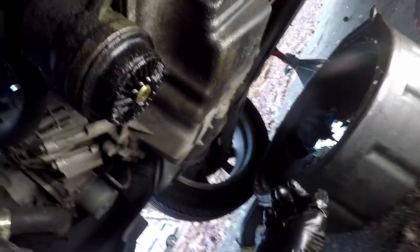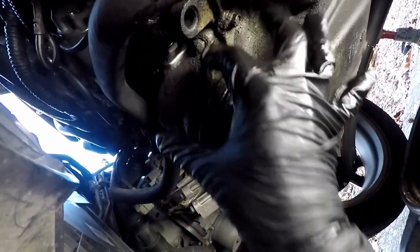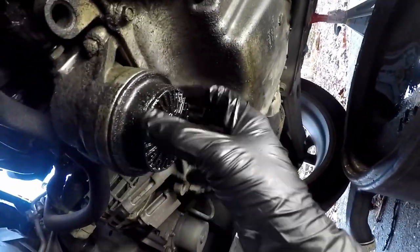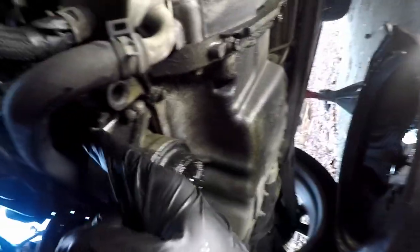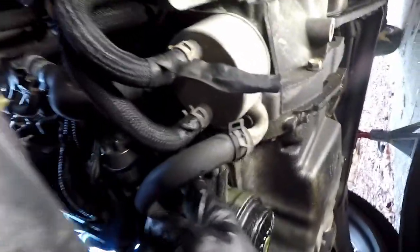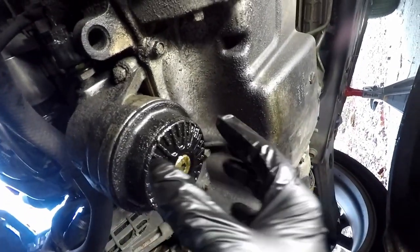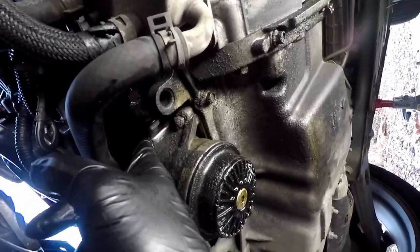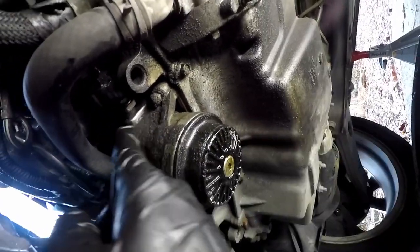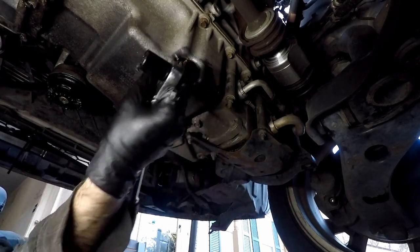While that's draining, let's take a look under here. You can see the caked-on oil on top of the oil filter housing — this is a cartridge-style housing. It's wet down here, but if we make our way up we can see trails of oil dripping down, with caked oil higher up and wet oil lower down. We also saw wet oil on top of the valve cover, so that's how we know it's a valve cover leak dripping down — not a rear main seal or the oil filter housing leaking, because the housing shows caked oil rather than fresh wet oil.